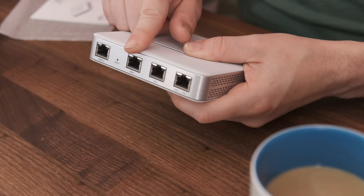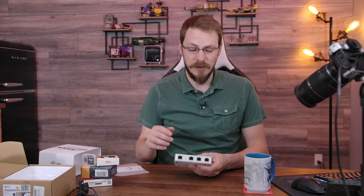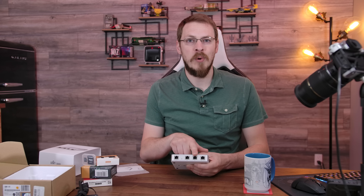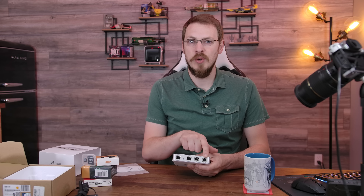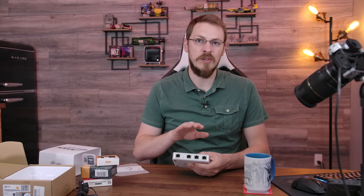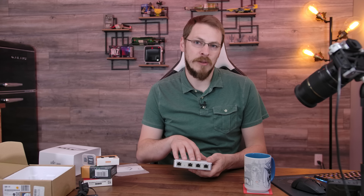There is a WAN 1 connection, which is your connection to your ISP, either through your cable modem, fiber provider, or a DSL connection. We have a LAN 1 port, which goes out to your local network switch, and then we also have an optional LAN 2 or WAN 2. So depending on if you want to do multiple VLANs or set up multiple networks, you can do that all with a single gateway and firewall.